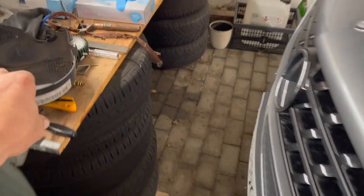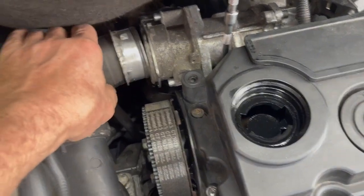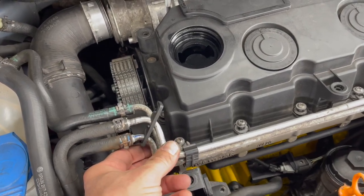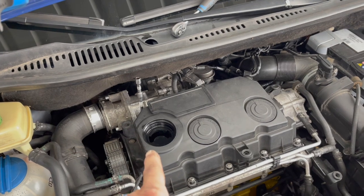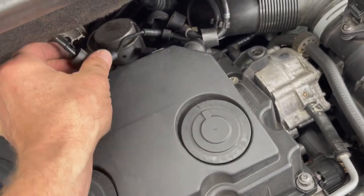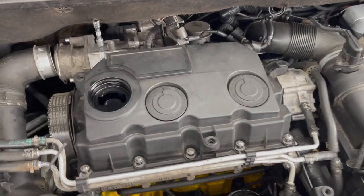The timing belt cover has two clips on either side. To remove the cover you need to pull the intercooler tube loose - just pull this clip out until it stops so it's not engaged anymore, and slide that out of the way. Then you can slide your cover out. Make sure you get all your valve cover bolts loose so your fuel rail can get out of the way too. You also have to disconnect your breather vent and this vacuum tube.